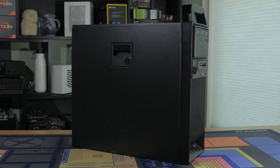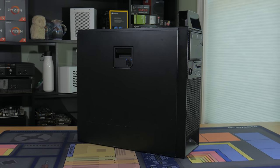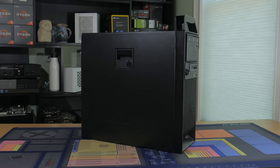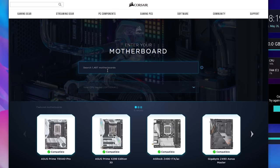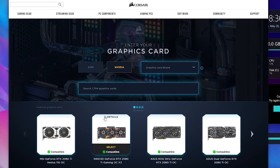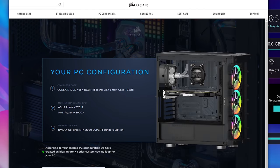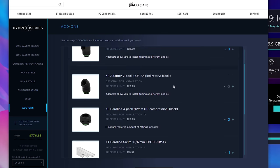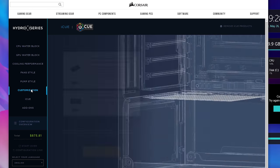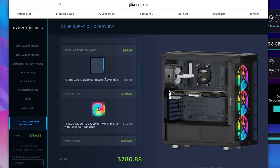With the drive cages out, I could now start figuring out how I was going to install each component. I did some measurements of the case to figure out what size radiator would be able to fit, then I headed over to the Corsair Hydro-X configurator. This allows you to input the components you're going to be using, and it gives you a full list of what you need to water cool those parts. This was super helpful for a noob like me, because without it I'm sure I would have forgotten something. This kind of gives you the minimum of what you need, so getting extra fittings isn't a bad idea.